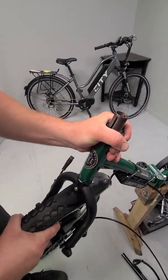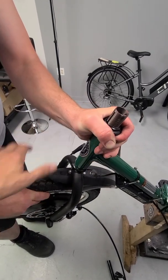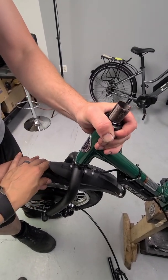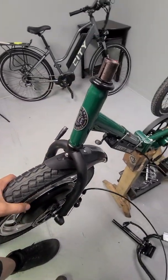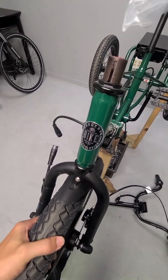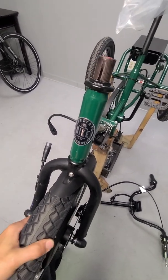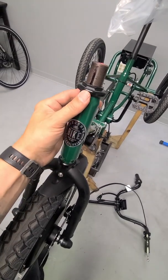At this point, what you want to do is exactly what Brian's doing — just hold this right here and as you turn the wheel, keep it a little bit snug. You just want to make sure there's no pressure and no play in this. A good way to tell that you have this installed correctly is while the bike's on the ground, you want to rock it back and forward and side to side, and make sure there's no play in here or in here.